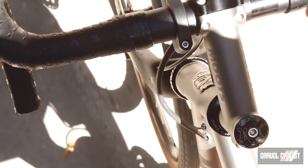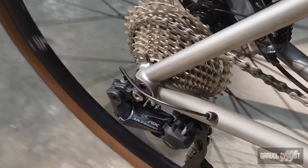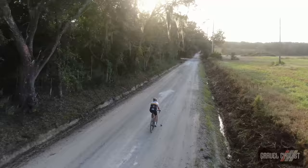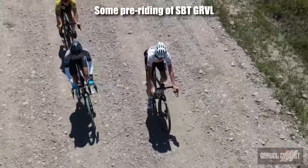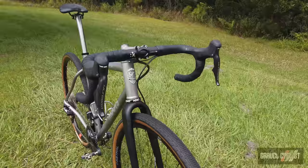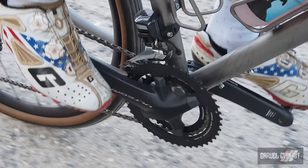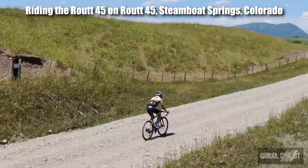The Moots titanium stem isn't cheap, but when you're buying a Moots I say life's too short — get the stem, and whilst you're at it, get the Moots titanium seatpost which also features on this review bike. The groupset is Shimano's well-proven Ultegra Di2 with the RX clutch derailleur. I do expect we'll see later versions of this bike spec'd with GRX Mechanical or Di2. This build features Ultegra Di2 hydro electronic brake shifters with an 11-to-34 cassette and a 46-36 chainring pair on the front. I substituted the 36-tooth small chainring for a Wickworks 33-tooth chainring, which makes all the difference when climbing.